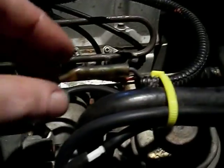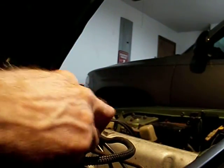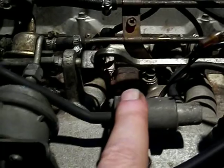Okay, so that should typically happen, I would think, only after the engine is warmed up. Now, just for grins, we will de-energize it. Excuse me, I don't want to break any wires. Hold on. Okay, the solenoid's obviously disconnected, right? Bleed off the vacuum. Try it again. Still doing the same thing. So what that's telling me is that this EGR valve is working regardless of what's going on with this solenoid valve, which tells me this can't be right.